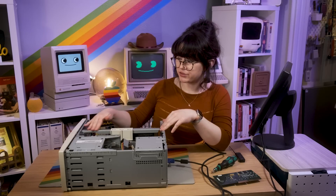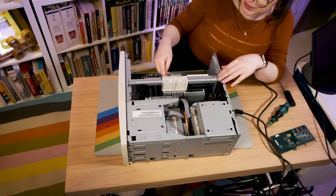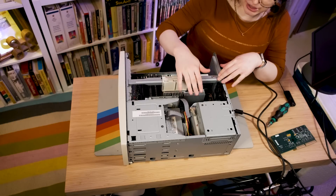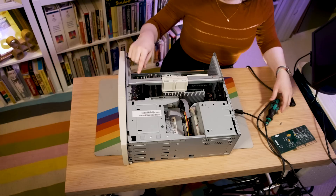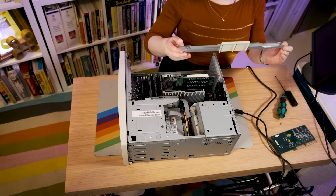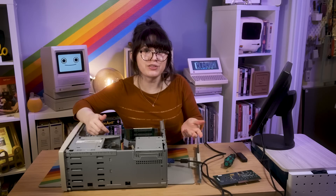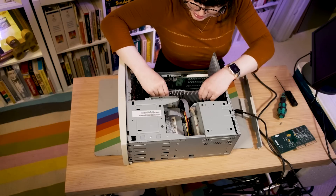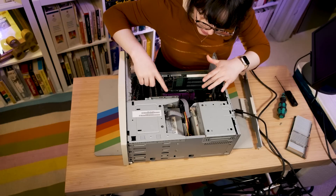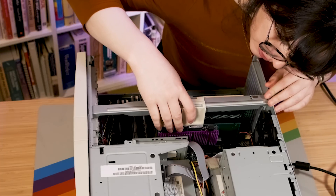So let's take out this old processor card. In order to do that on this Power Computing Power Center 132, we have to take out this crossbar right here, which is added for support so that when you place your monitor on top, it doesn't crush everything, and so it can support the PCI riser card and the CPU card. Let's undo this screw and it should slide right out. Push this forward and that pulls out — ta-da! We got this little bracket here. This piece of plastic holds down the CPU card, so once you have that bar out, the card should just slide right out. We simply replace it with this 500 MHz processor card that slides right in. Now we just have to put the crossbar back on so it lays on top of the CPU card and the PCI riser card.